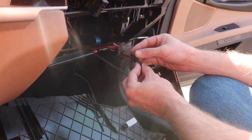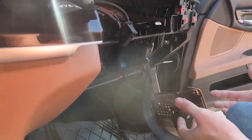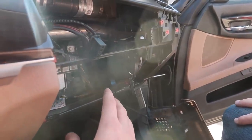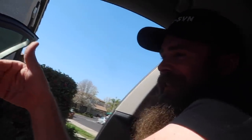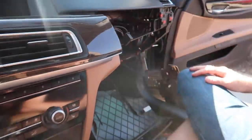So we're just going to clean up all these connectors and get all this corrosion out of there. Everything in there looks just dirty — it looks like someone sprayed this thing or something. This car has so many issues, it's not even funny. The AC was working when I got the car, so that must have just corroded over time — I was driving it a lot. The pin probably corroded and then finally just gave way. So we're going to have to get a new module and clean this stuff up.